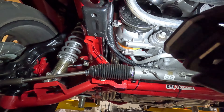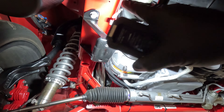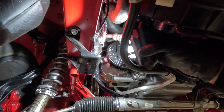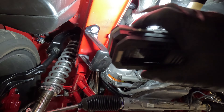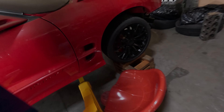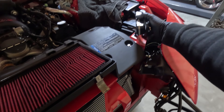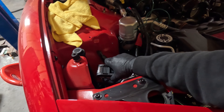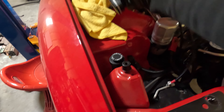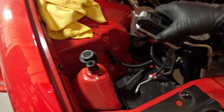On the other side, we've got a couple new ones. This one used to go up on the fender, kind of halfway down the fender. I didn't want it up there, so I moved it down to the bottom — I'm going to pin it right here. And then this is an additional one. Actually, that's the positive for the new fuel pump, but there's also a negative I'm going to try to pin down here along the bottom. I've got all the grounds hooked up on the bottom. There used to be one that came off the ground and came up here and looked terrible. I made a new one to go underneath to the bottom of the frame so I don't have to look at that nastiness. I went ahead and set the filter in.